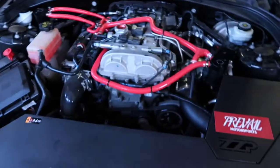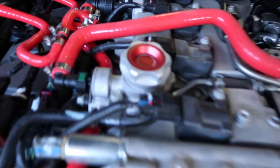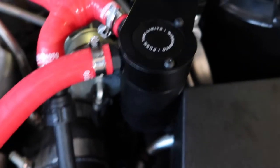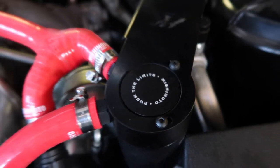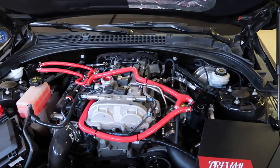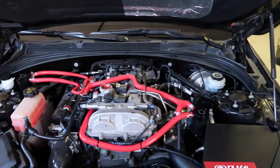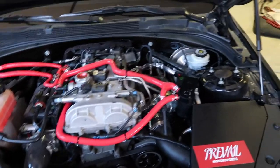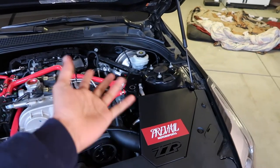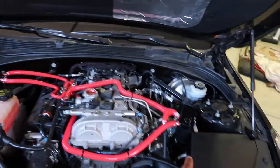Here's a quick outro — I forgot to do this yesterday. Under the engine bay of the ATS you can see the oil cap is installed now. I really like Mishimoto's slogan 'Push the Limits,' it's on the catch cans too. I went ahead and did a test drive yesterday and it felt as standard — you can't really tell performance-wise, but I'm pretty sure it's definitely helping the blow-by situation. The service interval for the catch cans is a thousand miles, and I've only put about 20 miles on it so far.